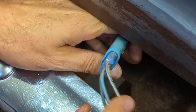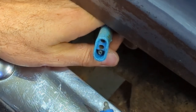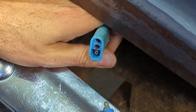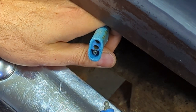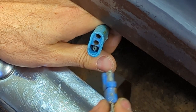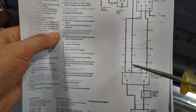So what we're going to do right now is test to make sure the black and white wire has power. I'll break this plug apart. The black and white wire is the top one in here. I'll ground out my test light — everything's a bit rusty. Trying the bumper — there, we have power on the black and white wire to this last connection right here before the tailgate. That means the power is coming directly from the battery straight back to this connector.